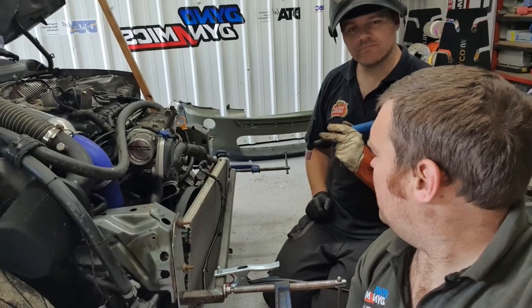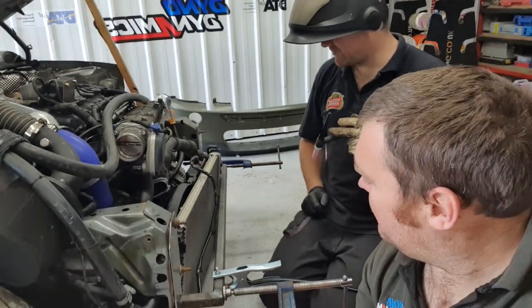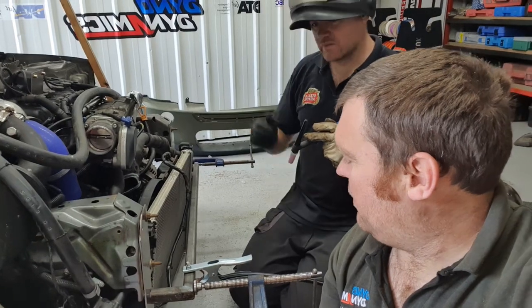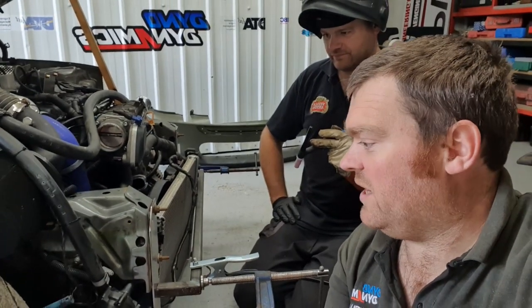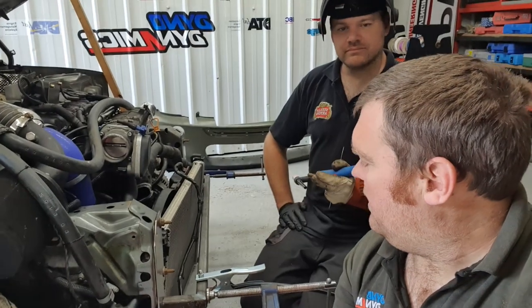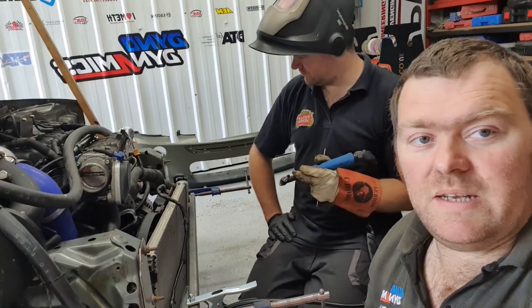It's been a very good Saturday morning. The brakes update — we have ordered new brakes: we've got some Brembo 275 Megane calipers coming and we're going to run the 330 GP2 disc, so hopefully that'll get rid of our braking issues. We're going to stick this in here now and then get these rads mounted.